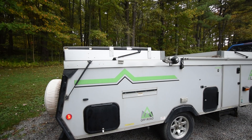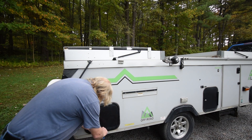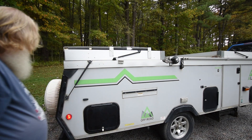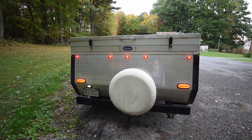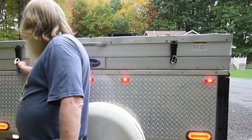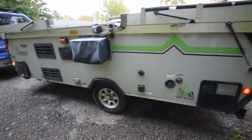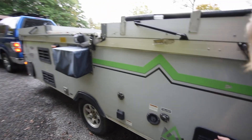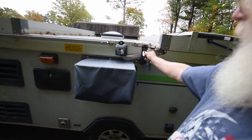Then I move to the back — check and lock this cabinet hatch. Marker light is working. At the back of the A-liner, the four-way flashers are working, which tells me my blinkers are working. The marker lights for the license plate and the marker lights across the top are lit. The latches for the dormer are in place and latched properly. I always look at this latch to make sure it is perpendicular to the slot for opening — that is latched.